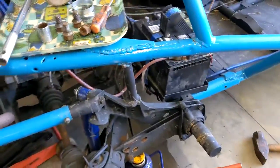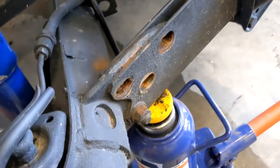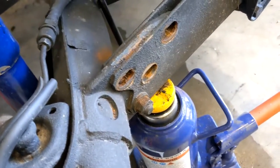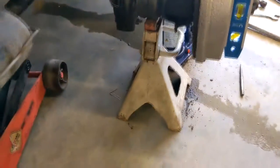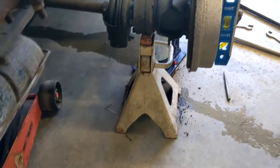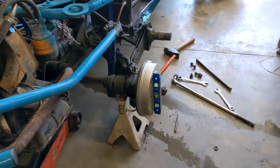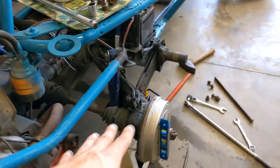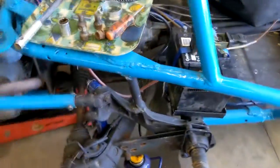So I'm coming back in and fixing it. What I'm doing now is I took out three out of the four bolts — some setups only have three bolts — so just leave one left so it can pivot off that one and won't fall apart. I threw a jack stand under the rear hub assembly so it acts like the tire's still on there but I still have access to everything, because you've got to have the load on this rear axle or nothing will sit right.